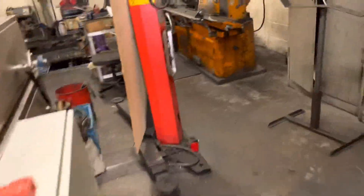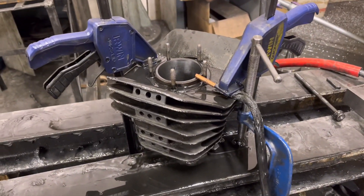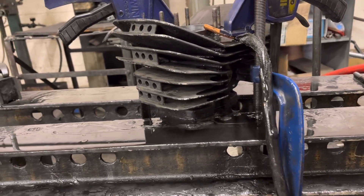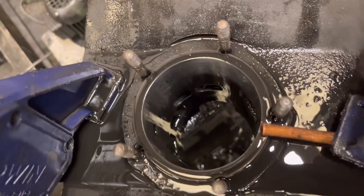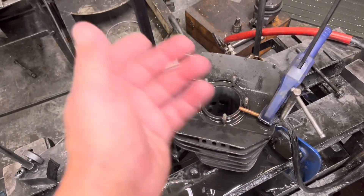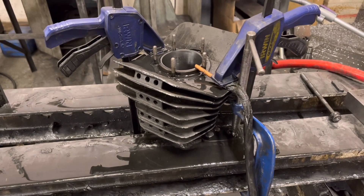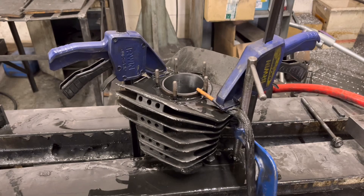While we're on the subject of old air-cooled that are a nightmare to hone, let's go over here. This here — I don't know whether any of you can recognize this — this is a Maico 250. You can see there the very distinctive set of fins for the air-cooled barrel. Inside these Maicos the 250 is not so bad, but they are an absolute maze of ports, especially the big 490s. You've got to be very careful when honing them that a stone doesn't get stuck in one of the ports and cause catastrophe. The Maico back in its day — absolutely wonderful machine. I think it won quite a lot and a lot of guys use them these days in classic motocross. We seem to get quite a lot of the old Maicos, believe it or not.